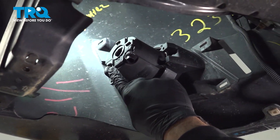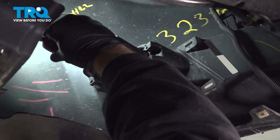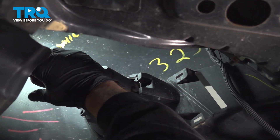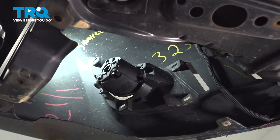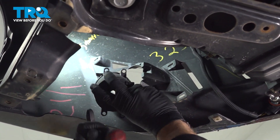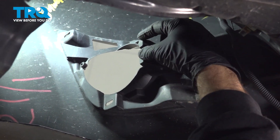Pull that unit out. On the back side of your fog light, there is a Phillips head screw on the outside here. We're going to use our stubby screwdriver to loosen and remove that screw. Once you pull that screw, go ahead and grab the fog light — we're going to twist that out and pull these two little tabs out of the bumper right here.